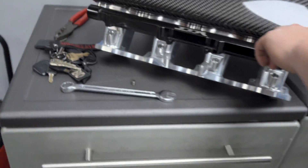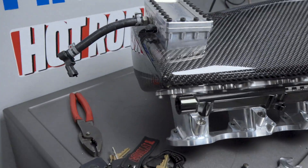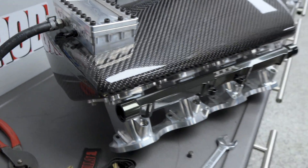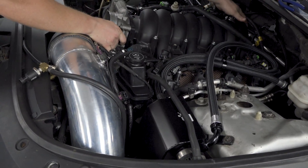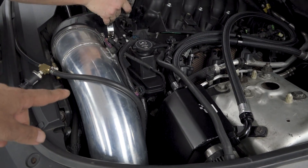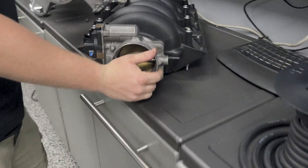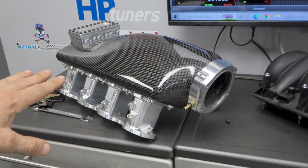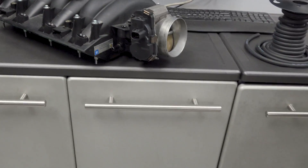Getting it all set up — a little makeshift there, but that should work okay, this is just for a test. What we did on the GT500 manifold is we had them add a spot for a MAP sensor, so we'll go ahead and do that on next versions. For those wondering in the Ford world why the pipe is so large, it's because it's tuned with mass air and it's just easier to go with a larger pipe and use the stock mass air. Obviously very, very different intakes — the higher you go up in power, the bigger the difference it's going to make. I'm hoping for a big RPM difference here.